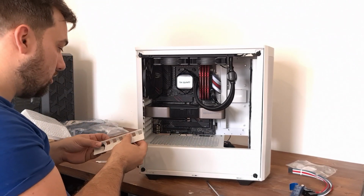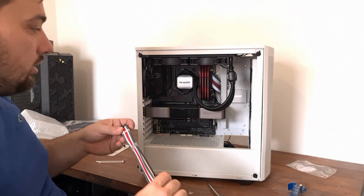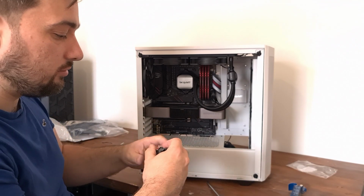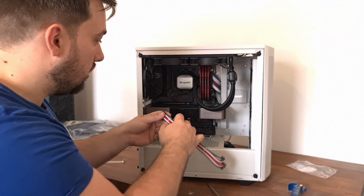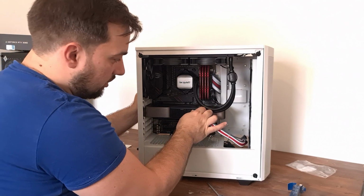And then with this one, as I say, you've got these screws here, place the cover back over. Then lastly is PCIe power to your graphics card. Again, these nice custom cables I've got, which are two 8-pins to one mini 12-pin. So going to look really nice rather than the standard black horrible thing you get with this card. Literally as simple as plugging it in.